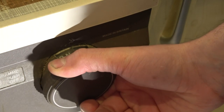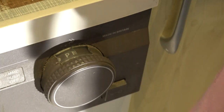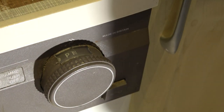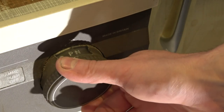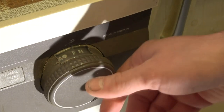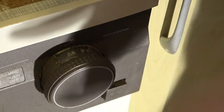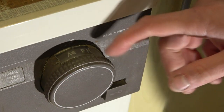So that's your first rinse, that's your second rinse, and then you get to program N, which is your special treatments / fabric softener on program N. Then it gets to crease guard, and then you press crease guard, and it goes into program P, and then it's a short 500 RPM spin before ending on the off position.